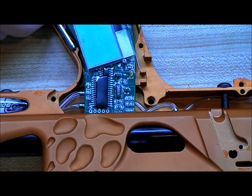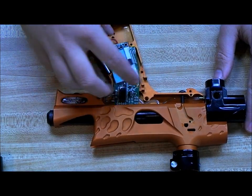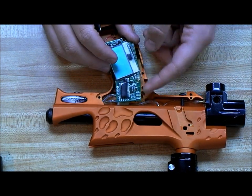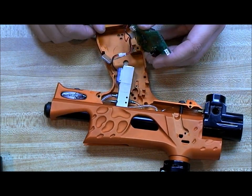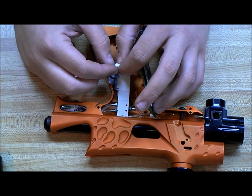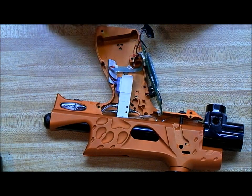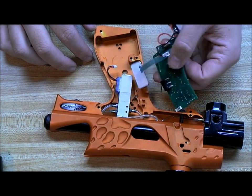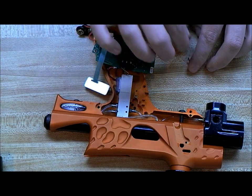Just like Allen keys, it's very important to have the correct screwdriver. You can just lift the board out a little. Now you have to be careful — this one doesn't have eyes in it. If it did have eyes, you'd have to stop here and pull out the eyes. Since we don't, we can just flip this over and take off the membrane pad. You can see the connection for the solenoid — just grab the connectors. It's always very good to grab the Molex connector; you do not want to grab the wires. If you tug on the wires too hard, you will pull them out and wreck your harness. There's the board.